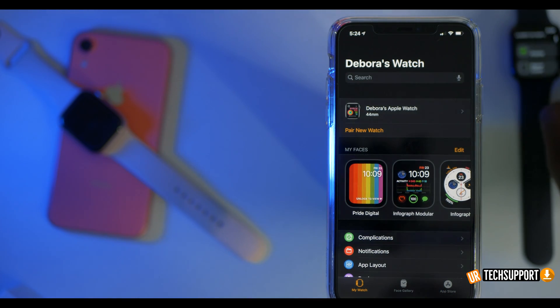Every time you see your iPhone app asking you to update in order to properly pair your Apple Watch, that's an indication your watch and iPhone are not at a compatible firmware level. If you can't get to iOS 13, you're kind of stuck. You can reach out to Apple to see if they can help downgrade the watch firmware or get you onto iOS 13, but if you're not on an iPhone 6s or newer, you're probably out of luck.